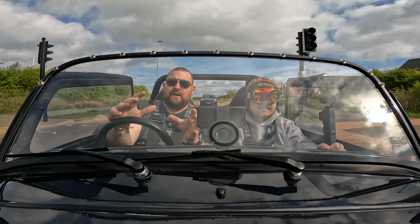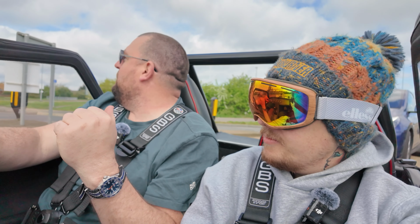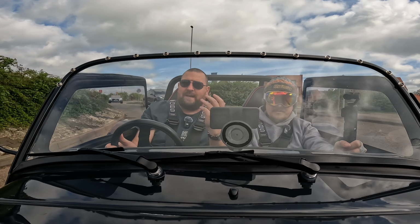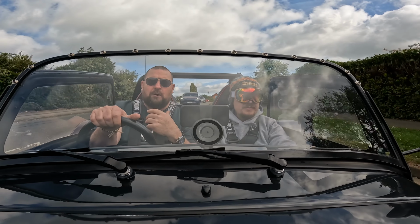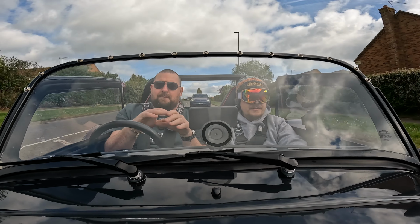Now with an open cone, they work really well, maybe if you've got a bit more of an exposed filter to the elements, so that you can have air to that all the time. Now when you don't, you can suffer from what we call high IATs, which is high temperatures of airflow going into the throttle body. Now that restricts power, you lose out on all the fun, power, everything else you're going to get from the normal drivability of the car, a lack of throttle response and everything else. So, especially normally aspirated applications like this, they love cold air feeds to them. It gives a nice big plenum, which is a volume of cold air being pulled directly into the throttle bodies at the time as well. And it just works really great for this sort of application.